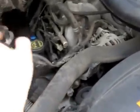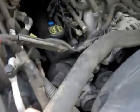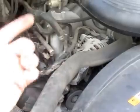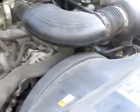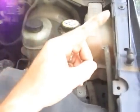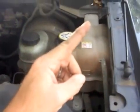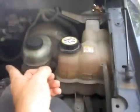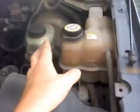I'm either going to have an exterior leak, like at a hose, or an interior leak, like a blown head gasket — something leaking antifreeze internally into the engine. I'll know because the pressure tester has a gauge. When I pump it up to, say, 20 pounds and I watch it drop down to 5, 3, 2, then I know there's a leak somewhere.